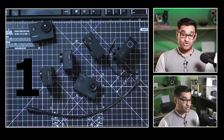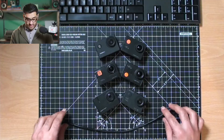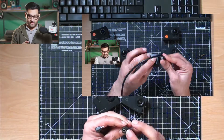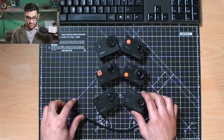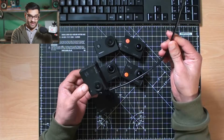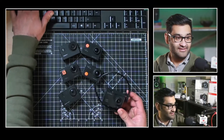Based on the cameras here, I've done a lot of testing. The first option is a cable — a micro USB to a microphone cable. You may find lots of YouTube videos telling you that you can use a micro USB to 3.5 millimeter adapter to attach to your cameras and add a mic. Unfortunately, that does not work at all. After six cameras worth of testing, it just doesn't work.